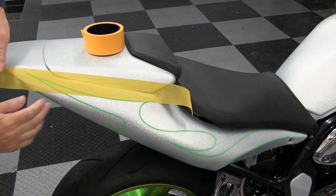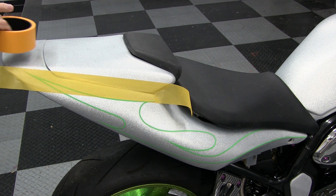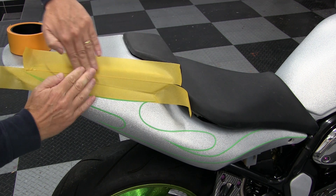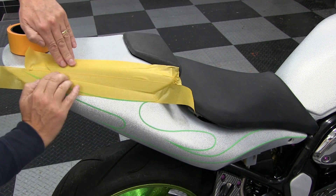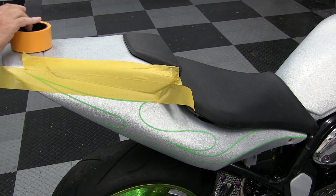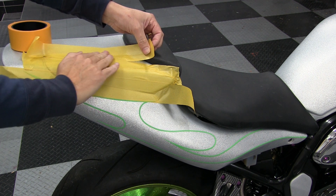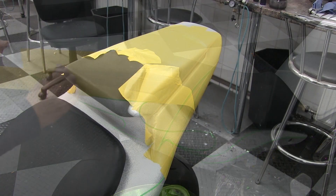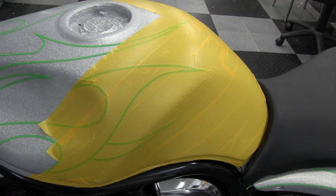Now I'm going to mask up the area. These scallops are only one section of the design — I'm also going to put some airbrushing on here, so I'm going to mask up for that as well. I'm just using the Flake King masking products — these are just 2-inch tape — and I'm laying them down, mummifying the surface, trying to get all those bubbles out and getting everything ironed out. This is going to be my positive area, which is actually going to be the last section I paint on the motorcycle. Keep those overlaps down to an absolute minimum and try to get all those bubbles ironed out.